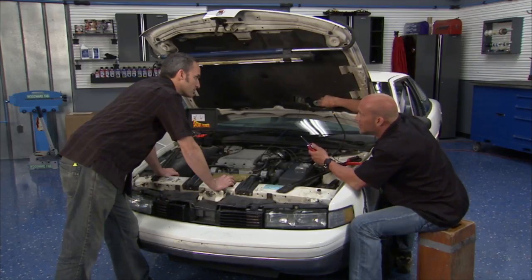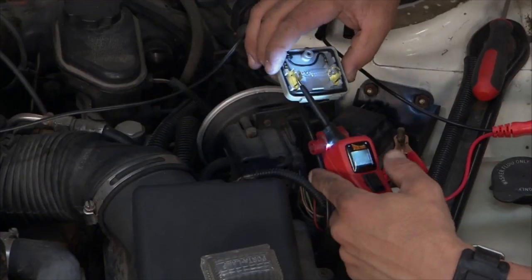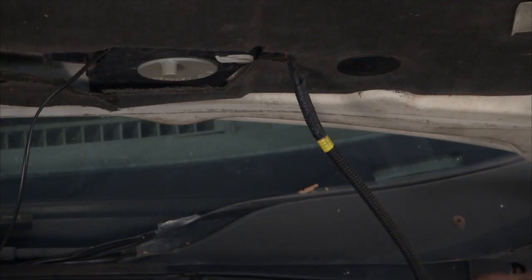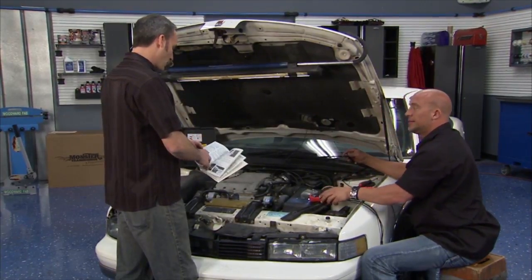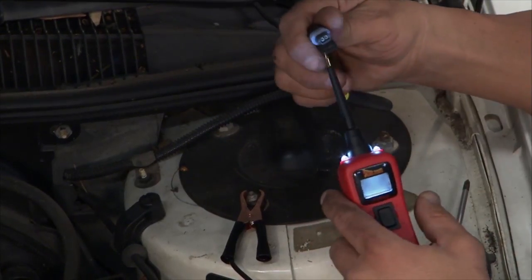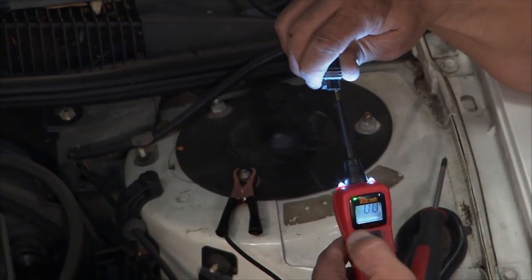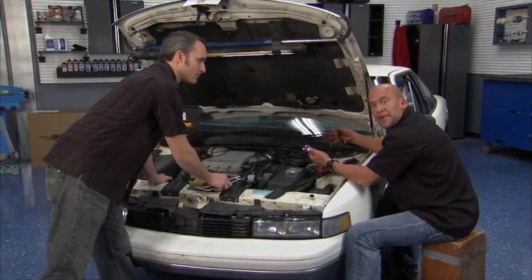We should check just to make sure — he says it didn't work. There's an on/off switch. Let me look up the manual and see what I can find on that circuit. Now I'm going to throw 12 volts and see if this bulb actually works. It does indeed, so we know it's not the bulb. We're going to start tracing it back. A good way to check here is if you stick this probe in here and it goes green, that's saying you've got a good ground. If you hit the up button, it's going to throw 12 volts at it and flip a circuit breaker in the Power Probe. It tripped the circuit breaker, so you know you got a really good ground there.